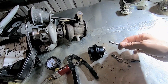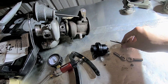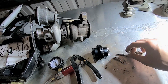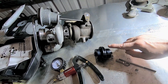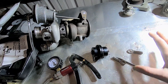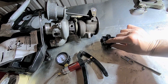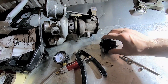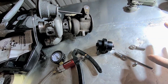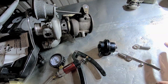A lot of people actually put the rod in backwards, believe it or not. You put it in, tighten it down, but what you don't realize is the piston inside is just spinning and now you're causing wear to the piston. There are a lot of issues you can have: leaks around the seam, leaks at the actuator port — this is actually a pressure line — you could be losing boost at this thing and not even realize it, because in your mind you just put the thing on without understanding how it actually operates.